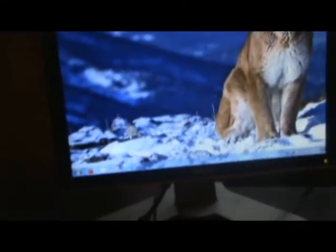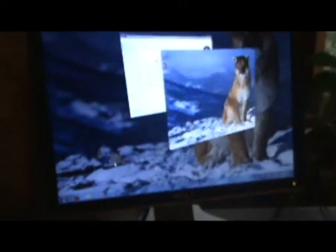And some people might think, well, why not a quad? Well, my grandma doesn't really do too much intensive CPU tasks, so throwing in a quad core wouldn't really be the best idea. But throwing in a 3 gigahertz dual core will definitely increase the single thread performance, which is what we want. And I'll probably throw in a better graphics card, because this machine currently, as you can see, kind of lags when it does stuff like that, and that's because it's got the integrated Intel GMA graphics,